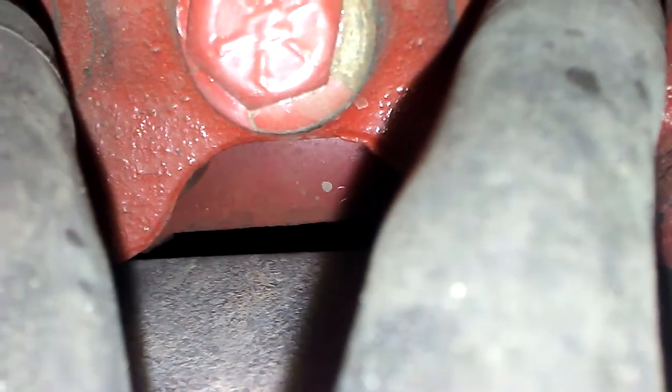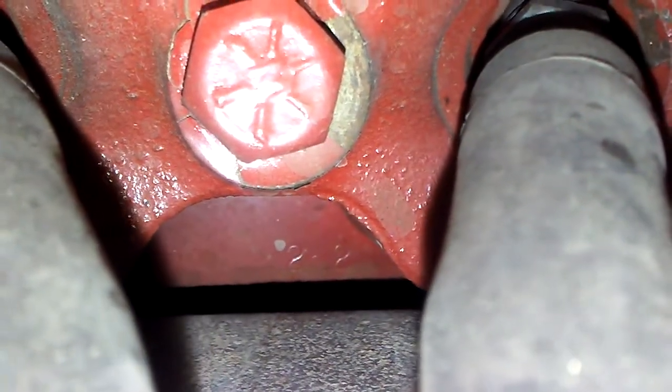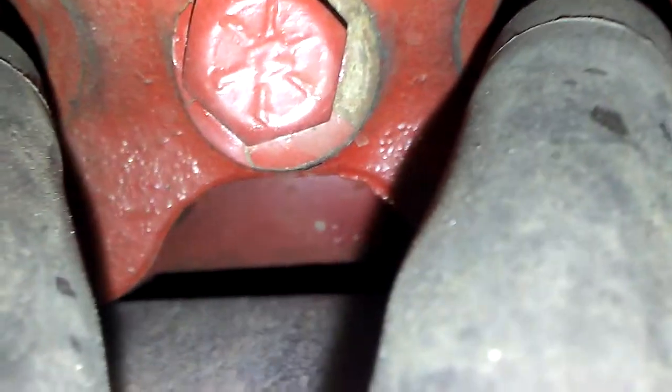Oh, one more thing. Also, I scored this pretty neat little air cleaner assembly with a 350-4 high compression sticker, which, if you guys don't know, is what this engine is. If you look down, right between the spark plugs, you'll see an SP, just very faintly right over there, and 252. Not too clear on what the 252 means. It might be like the day or the month the motor was made, but the SP is the code. You can see it faintly kind of right there. Oh, there it is. It was there for a little bit. Yep, that's just a 10 1/4 to 1, 315 horsepower, 410 foot-pound motor, and that's what this is.